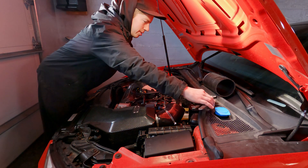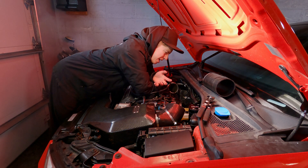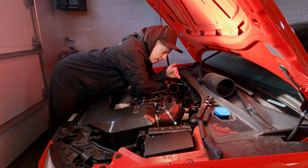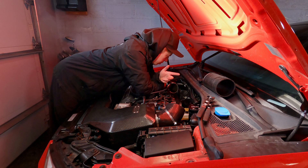I don't know why I didn't think about this earlier, but we've been dealing with a weird boost creep issue. It's not like traditional boost creep — the turbo isn't really spooling that hard, but at the top of the RPM it's greatly exceeding our spring pressure at the wastegate. I spoke with Sean at SRM because they sell these turbos and he'd be able to help troubleshoot.